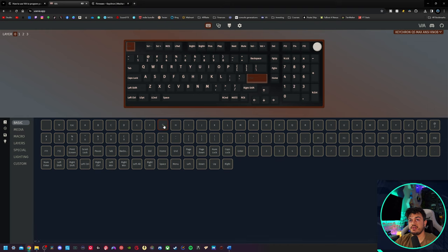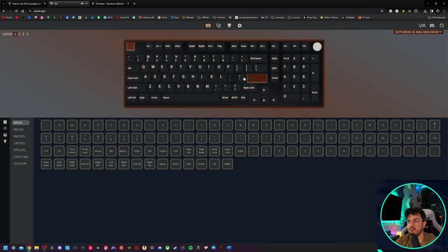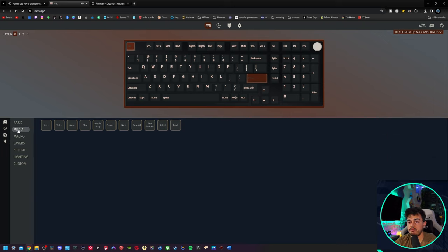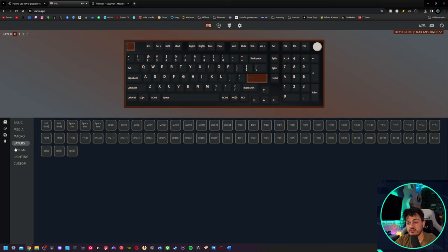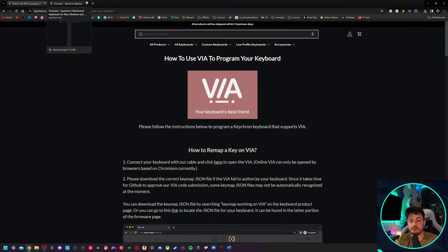Over in the configure tab — keep in mind this isn't an actual application you can pin to your taskbar like Razer Synapse or SteelSeries Sonar, it is a webpage with a URL. This is where you rebind all of your keys — if you want GBZ for some reason, you can do that here. The only things you cannot rebind are Enter for select and Escape for go back. You have media controls which can be bound to the knob — spinning clockwise, counterclockwise, and clicking it in. You also have macro support and layers for individual key RGB. RGB control can happen on-board on the fly, so you don't even need this app.